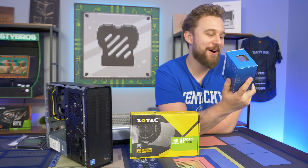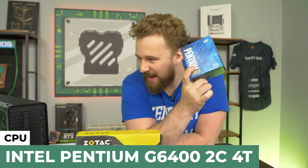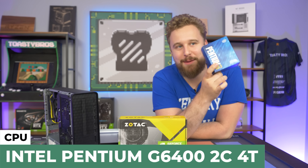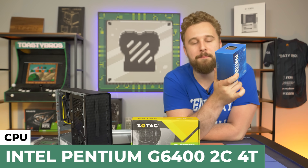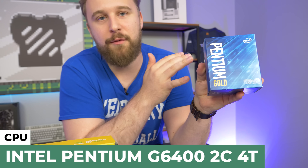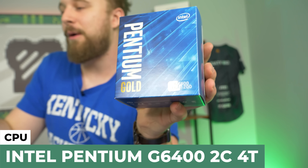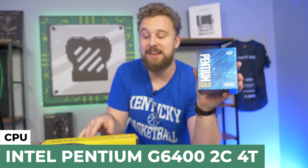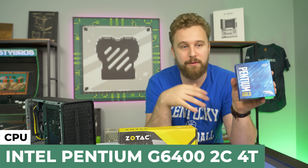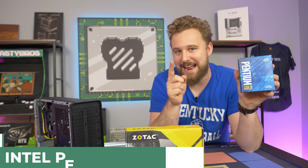For the upgrades — we're having second thoughts about the CPU but we don't know for sure, so there may be an audible to a different CPU at some point. But we're still going to go for a Pentium regardless. This is a 2-core, 4-thread processor — a pretty decent upgrade over just the standard dual core. The main reason we went with this over something like the i3 was that power supply, because we'd be really pushing it even with the GT 1030.